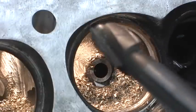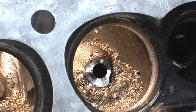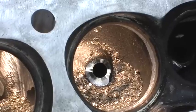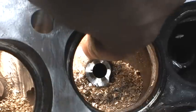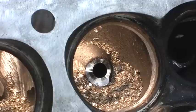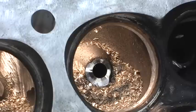I haven't got any aluminum yet except a little bitty tang — I need to go just a little bit further. All right, see I just barely kissed off a touch of aluminum right there, and now I've got the guide level with the bulge, which is going to take quite a bit of material out. I'll only have the 11/32 valve exposed when I go in there and taper the guide in that area on the very tippy top, roll it, make it a bullet nose — I would have picked up a few numbers in airflow. That's just one of the things — all aluminum heads, doesn't matter what it is from Brodix to Edelbrock, they just don't finesse them like this.